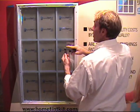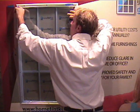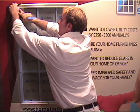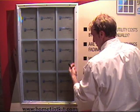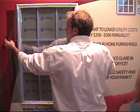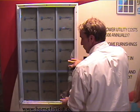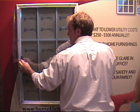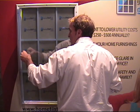One eighth of an inch on your blade. Start in the center and cut towards the corners. Once you've made that cut, hold your film and get the excess out of your way. Check again to make sure we're still lined up, and take your finger to run it into the corners to make sure we're all the way against the frame. Repeat the process again, starting in the center and cutting towards the corners.